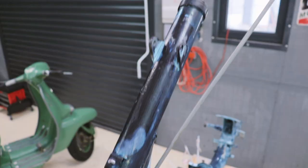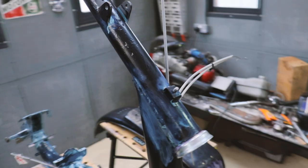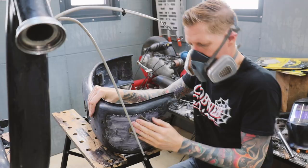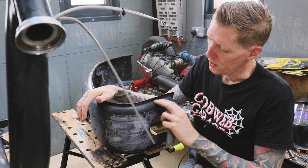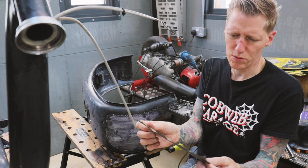There's the frame with a good coating of that rust treatment. You can see where it goes black after 10 or 15 minutes. I'm going to let that dry completely, and then I'll probably just start sanding — taking off any rough edges and a little bit of filler if it needs it in places. What I found with this rust treatment is that it dries with quite a shiny finish. I'm pretty sure the paint's not going to stick well to that, so I'm just taking some 280 grit paper and going over the whole lot to rough it up. Also where I've put a bit too much on there are a few drips, so I'm just knocking those back.